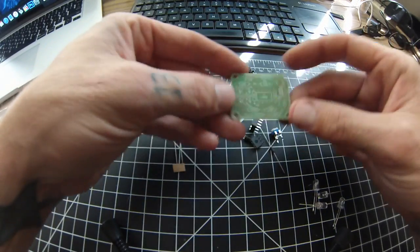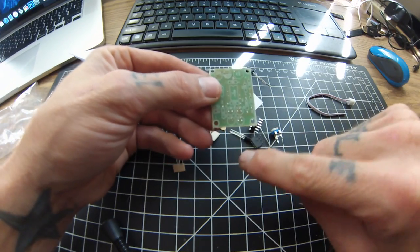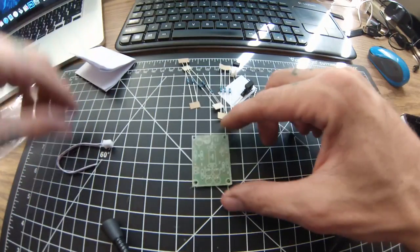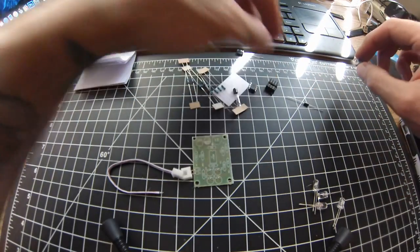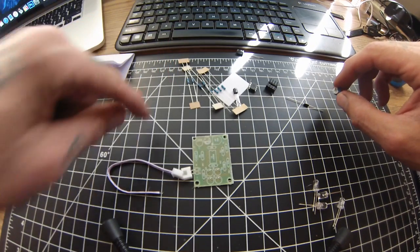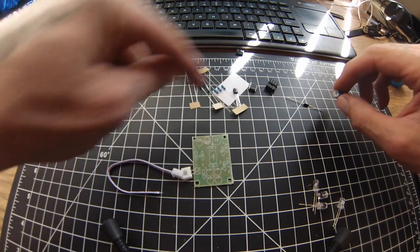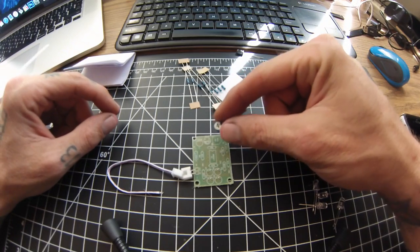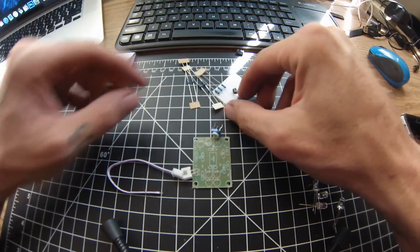putting the LEDs here on the board, I'm going to solder some wires coming out of there to go to my actual UnderGlow kit. So it looks like power will come in right here on this side from my secondary switch. So there'll be a main switch that turns the system on and then a secondary switch that decides whether it goes to this breathe module or if it goes straight to the LEDs to just be on all the time. It looks like that is the potentiometer to decide how fast or slow the breathe mod is.